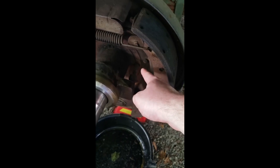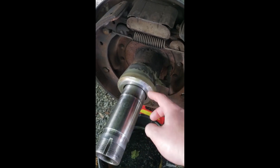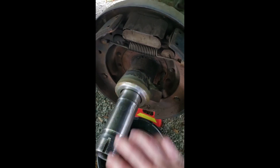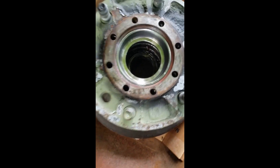This is truck air — it comes right from the truck into this sleeve, and air comes out of this sleeve here, out to the spindle. It doesn't just spread air all over the spindle; it actually goes right into the hub. Over here I have the hub where I can show you where it comes in.